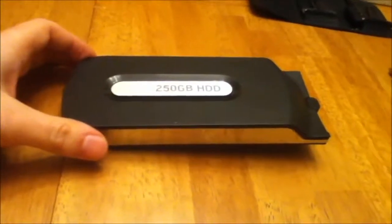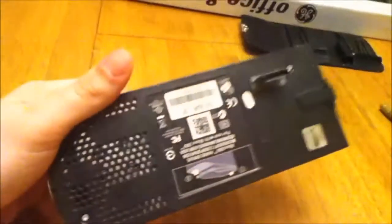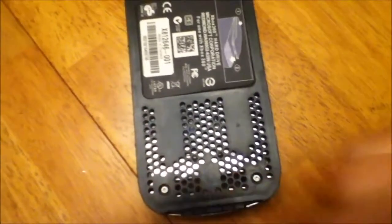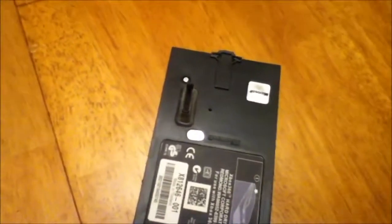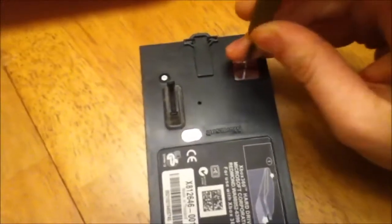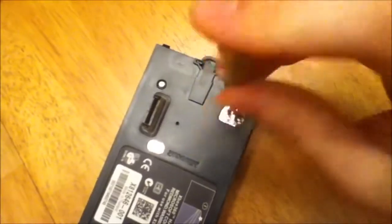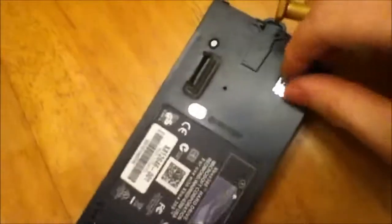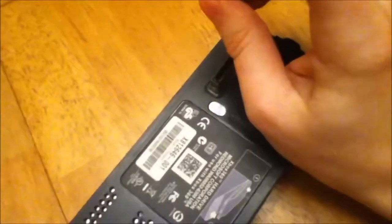Now to remove your hard drive from your case. Since you're going to be reusing this case, you want to be careful. There are four screws on the outside of the case — here under this warranty sticker, and here and here. These are T6 screws and you will need a Torx T6 tip. There's a screw under this warranty sticker — you don't have to remove it. You can just push the tip of the screwdriver in until it catches and then twist it right out. The sticker will come with it, but you yourself do not have to peel it off. Then just start removing the other screws.